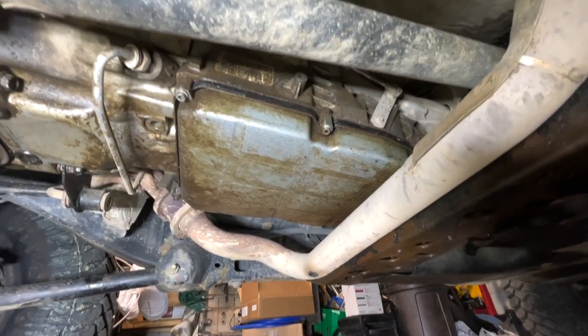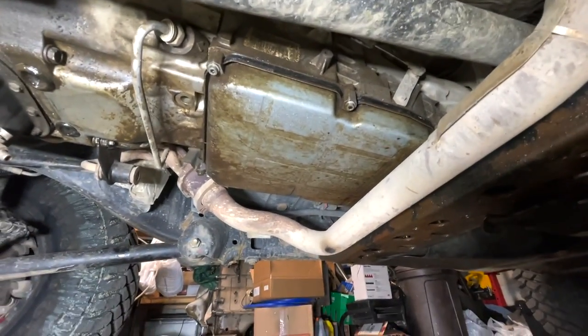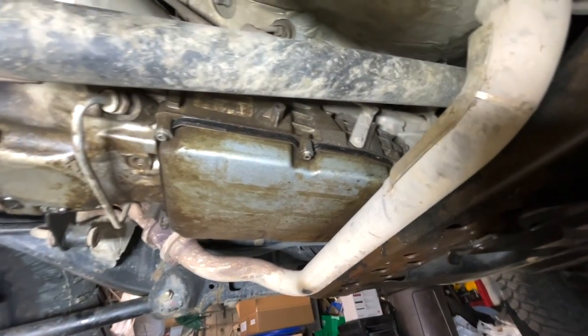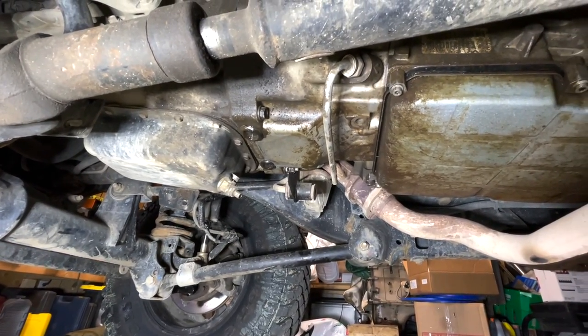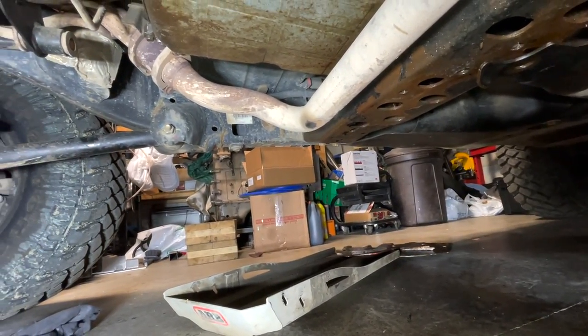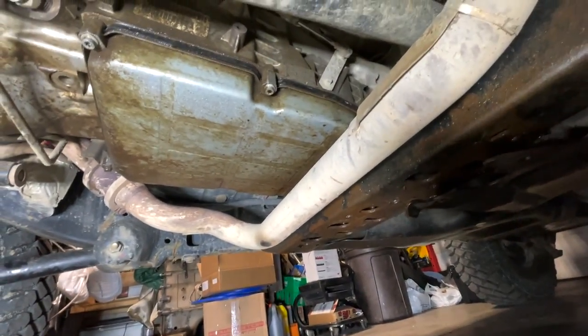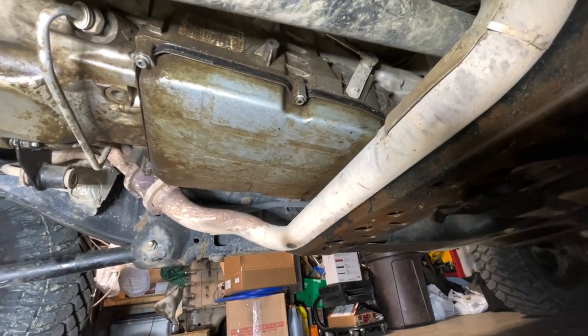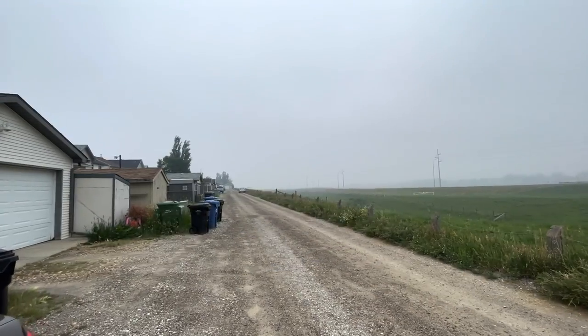So I got the new oil pan which takes care of it - it doesn't use these stupid clip things, it's actual bolts with a gasket, so we're going to drop this out and then investigate. You can see right there with the little small oil pan it's got that little quick drain with the spigot, and when I cut the hole in there and weld it back up so I can remove that access port, it'll be enough to get my hand up inside, put a tube on it, open it up and let it drain. Nice little easy project - some welding, some plasma cutting.